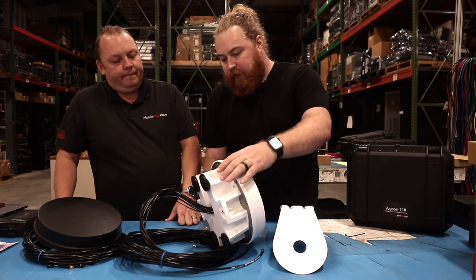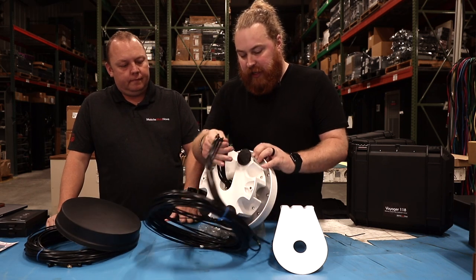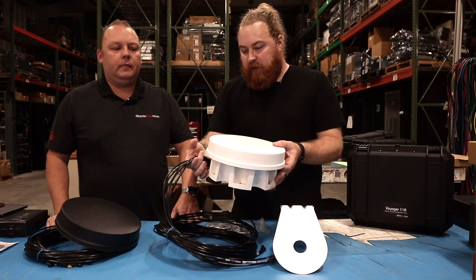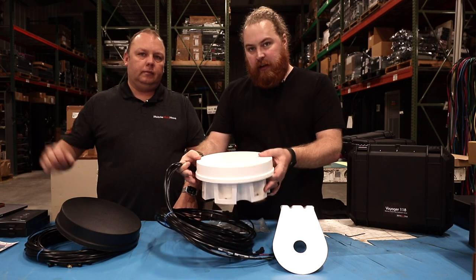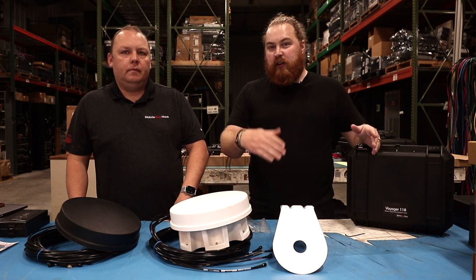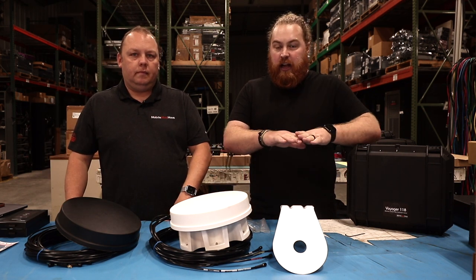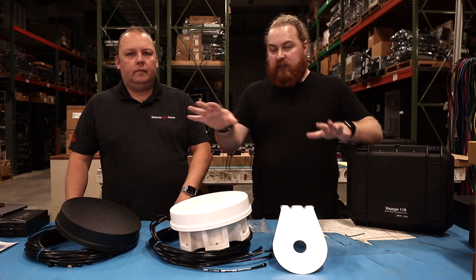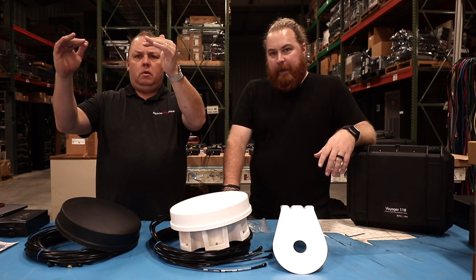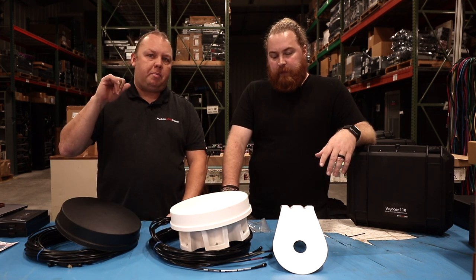What's great about the magnet mounts is that while this antenna goes straight down to wherever you're mounting it on the roof, the magnet has a side exit option. So while you could go straight down and then deal with sealing, this one is really more designed for some sort of exit that's not below the antenna. For example, if you already had a solar drop and wanted to run cables through that since you already had a good hole through the roof, this is a good option — you just need to put down a metal sheet and then magnet this to it. That's really popular for folks that have rails on Girard awnings because they can actually run these cables through the front cap or through the rear cap rather than through the roof.